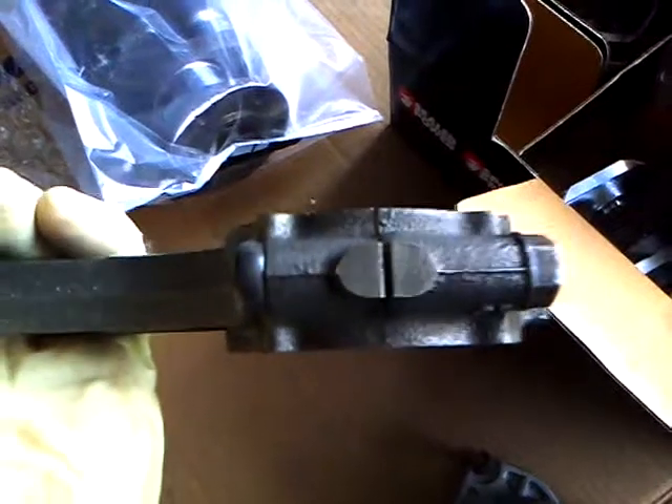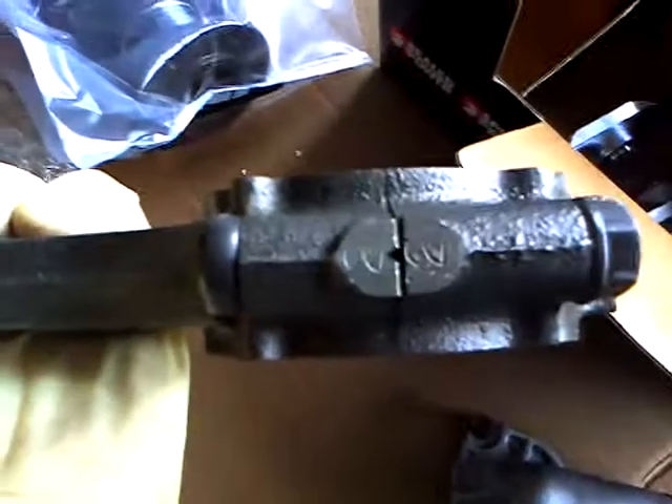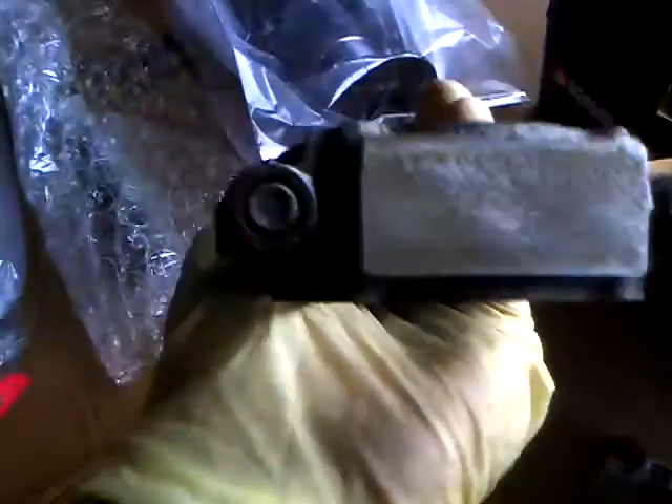You can see the directional arrow that points to the front of the block as I install them. I pre-punched these — they came punched from the factory with some weird code, but I punched them myself. This one, as you can see, is cylinder two, and I put a two on the back as well so I can see which one goes where.